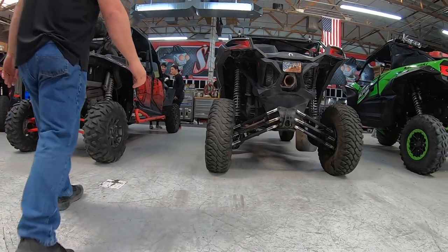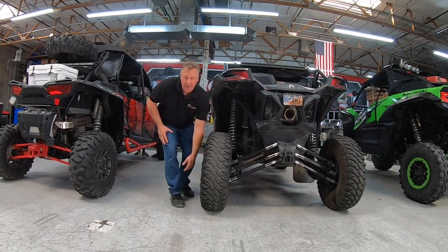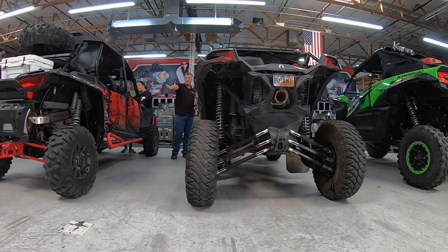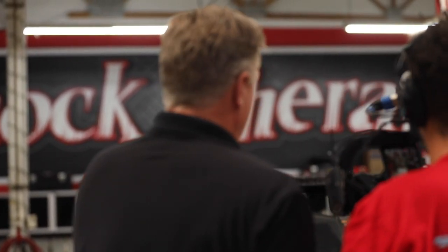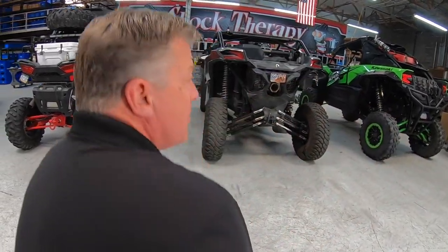What I'm looking for, what I want you guys to look at, is kind of put your eyeball on this, looking at this tire's angle compared to the front tire. So maybe push your head out a little bit wider so you can actually see this front tire in front of it. The easiest way to cheat or to shortcut an alignment is to step back behind the car and put your head in line with that outside edge of that tire, compare it to the front one. Believe it or not, your eyeball is very, very accurate. And as you start adjusting camber, and if you're trying to adjust the rears to match the front, eyeballs are within about 2 or 3 tenths of a degree.